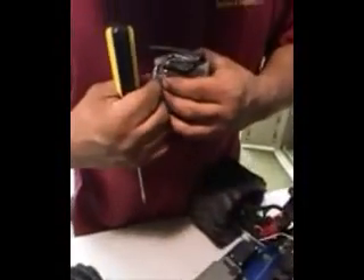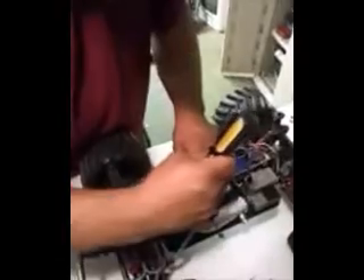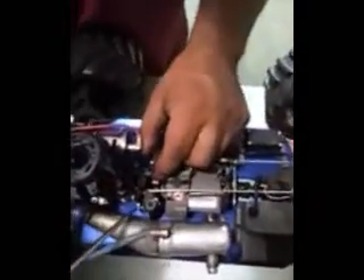When it comes off, you just want to hook it back up here. If you put this down, fuel is going to come out of the line. So you put your screwdriver in here and you pop that little linkage off. Then take a little snipper and you just want to snip the wire tie that holds the exhaust on, so you can pull this away from it.